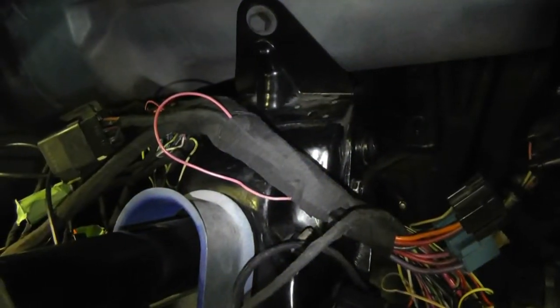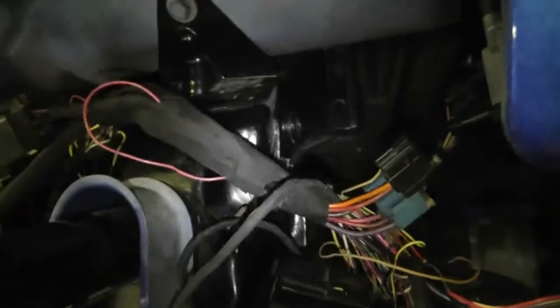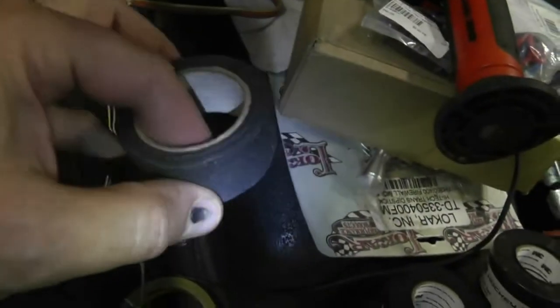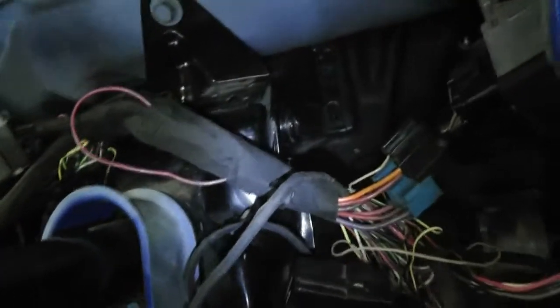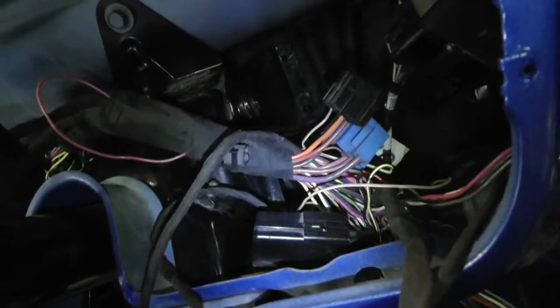Okay, so this is what I'm working on right now. I've got the harness in the cab of the truck, and I'm just re-wrapping the harness under here. I'm going to have to pull the fuse panel back out so that it can re-wrap closer in there, just because it's not that convenient that way. If I had one recommendation — I've been using this stuff, it's hockey tape. It's water-resistant, and it's actually a lot thicker than any kind of electrical tape. I think it looks better. It does a good job of wrapping joints, criss-cross, up and around. That's what I'm talking about. And I think it'll protect the wire a lot better than electrical tape would, or just leaving it alone.